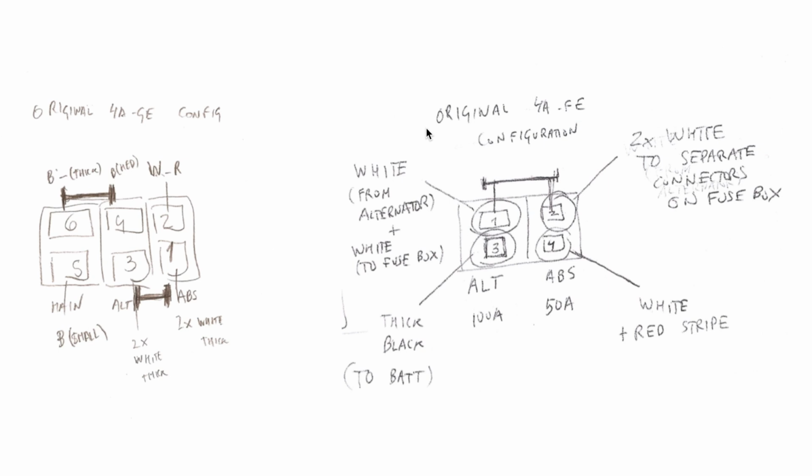And let's analyze the situation. The car is stopped. Okay, the engine is not running. And we have to analyze what is the flow of current in this situation. In this situation, we have to power things in the car. Even though the engine is stopped, electricity will have to flow from the accumulation circuit, that is the battery, to all the electrical appliances that turn on when you turn on the key, as well as the ignition, so that we can fire up the engine.